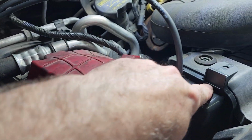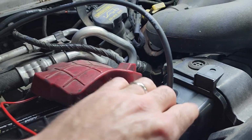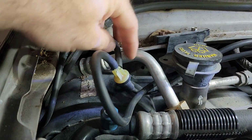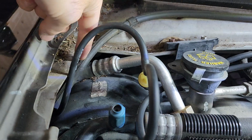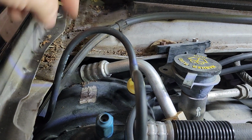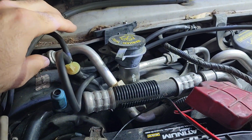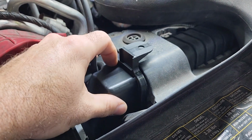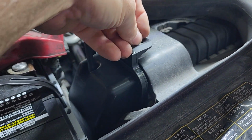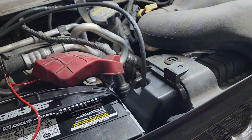And no, it's not a charcoal canister. Some guys are going, canister? No, it's a vacuum canister, storage can, whatever you want to call it. And then the other side of this valve where it sticks up, that's going to go straight down into the vehicle underneath the glove box, and that's where it's going to tie into all your controls in the dash and supply vacuum to make your vents go open and close. And like I said, I'll mount this right here, put a spacer, drill a hole and put a screw, and it'll be perfect, good as new, and we'll never have another problem again.